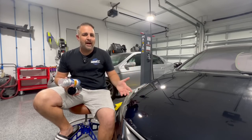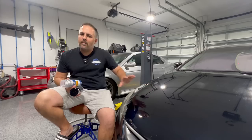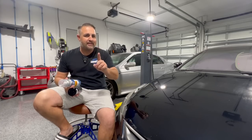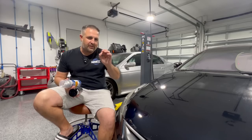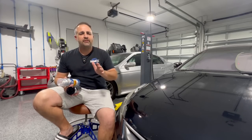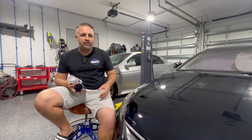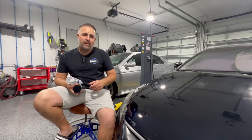Well, surely you can come back with the buffer and buff it so often so the line does disappear, but I don't want you to run into this on a new project. So those are words of wisdom. Don't go trying this on your brand new car. Just use the touch-up paint and touch a little bit of base and then clear coat and walk away or have a professional do it. Keep in mind that this is only for areas like corners or small spots on your older vehicle. This is a great technique to make it look better. And that's just what we had here.